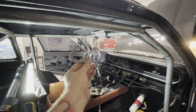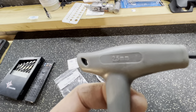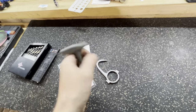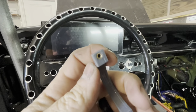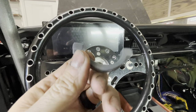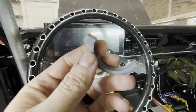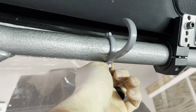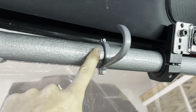To install this, it is an allen head and the size you'll need is a 2.5 millimeter T-handle. When you take it apart, there are nice nut certs put inside the plastic — so it's not just a piece of plastic that they've threaded for you to screw into directly, which would be cheap. It's pretty good quality on how it attaches together. The screws do just barely have enough thread to get it attached.